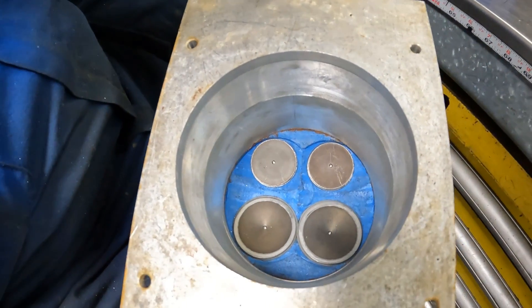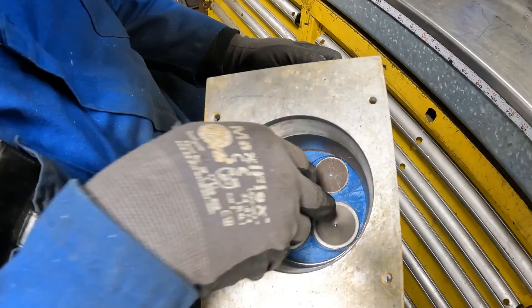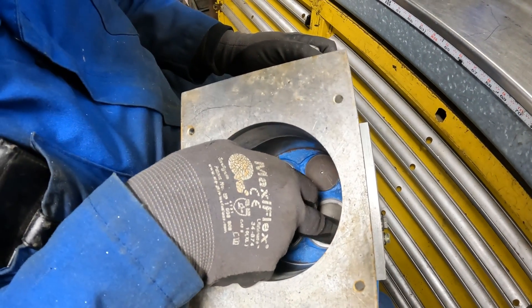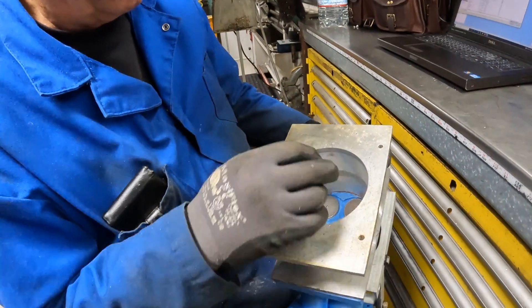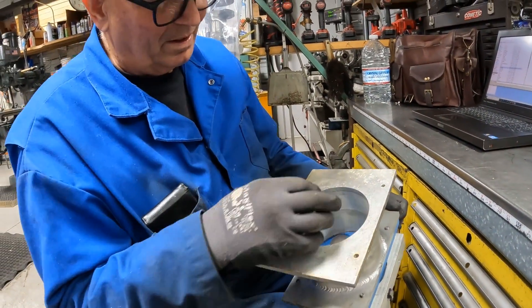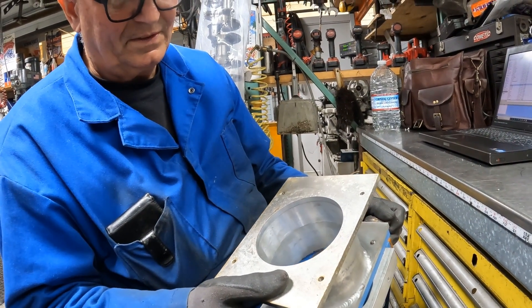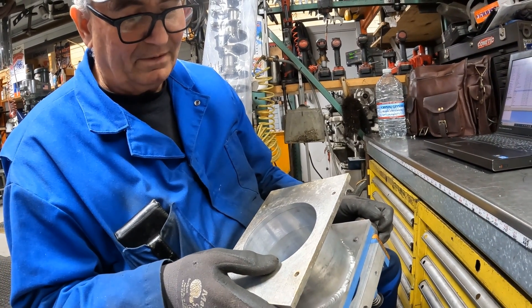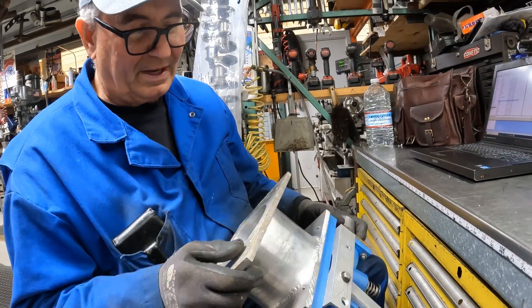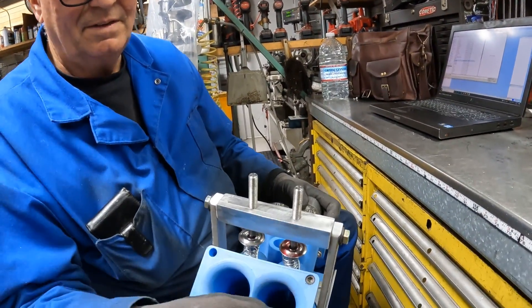There's the combustion chamber. The intake valve is a little shrouded right here, so we want to move it a little more to the center — maybe pull the exhaust off the wall about 50 thousandths and move the intake over about 150 to unshroud it, maybe go a little bigger with the valve, so that at 600 lift we can get 500 CFM.